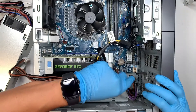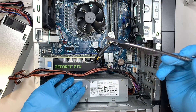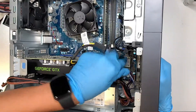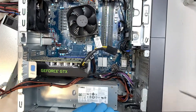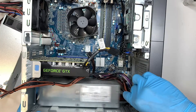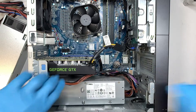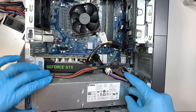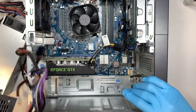That's pretty much it — we've disconnected all the cables. Get a long flat-head screwdriver or similar stick. What we want to do is push this little blue tab down and slide the power supply to your right. Once the power supply is out, you can remove it entirely from the desktop.